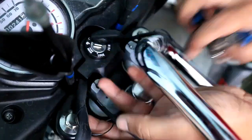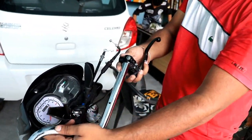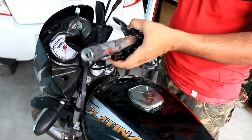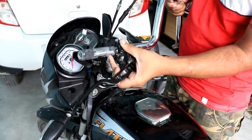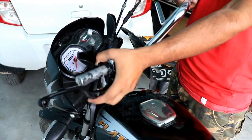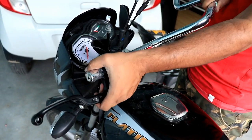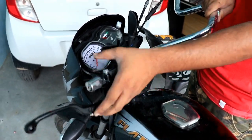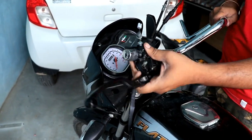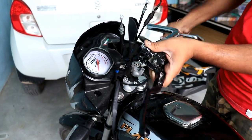The handle is completely free. Now I will remove both levers — the front brake lever and the clutch. The wire is linked. There is a front lever with the brake light and the clutch attached. If you open it and stretch the wire, the wire will get pulled. It is better to keep the handle the same as I am doing, so you don't have to pull the wire.